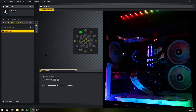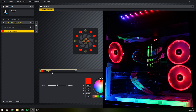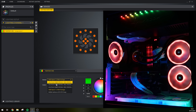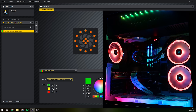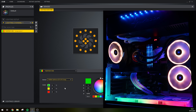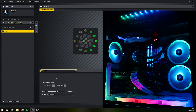We also have color pulse, color wave, sequential — which looks crazy — strobing, and rain. These effects are really in-depth with a lot of detail. There's also a temperature-based effect where the fan color reflects either CPU or GPU temperature. We're currently between 40 and 60 degrees on the CPU and around 40 degrees on the GPU, so you can get a rough idea of system temperatures just by glancing at the fans.